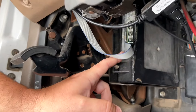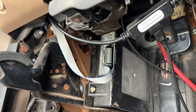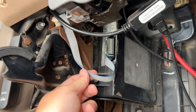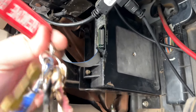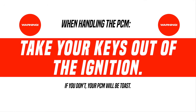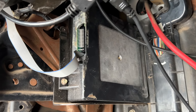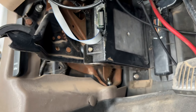So here's your PCM down here. The box is cut open and the Hydra is right in there, with your ribbon cable going up to your fuse panel and wherever you want to route it. There's lots of different places — you have a six-foot ribbon cable, so it goes anywhere you want. All the chip does is slide in and out. You need to be very cautious — your keys must be out of the ignition. If your keys are in the ignition and you touch this chip with your foot, fingers, or anything, you just bought yourself a $500 PCM. Very critical not to have any power. If this key is in the ignition and you touch this, you're going to have a dead truck. This should take no longer than 30 minutes max.